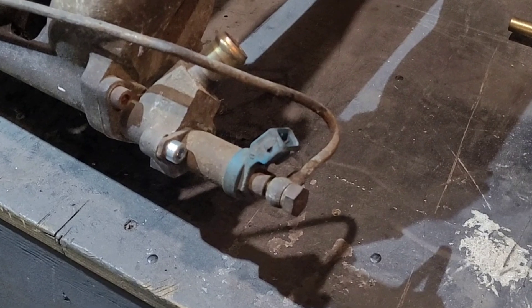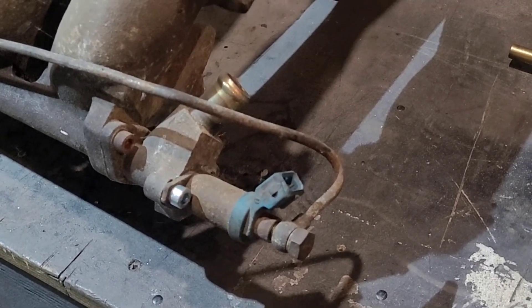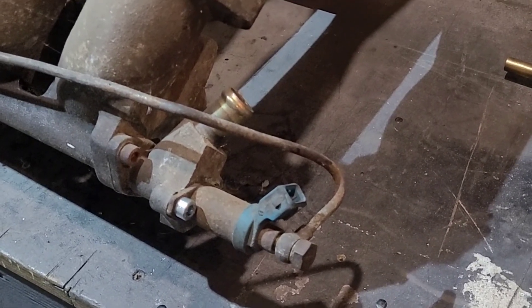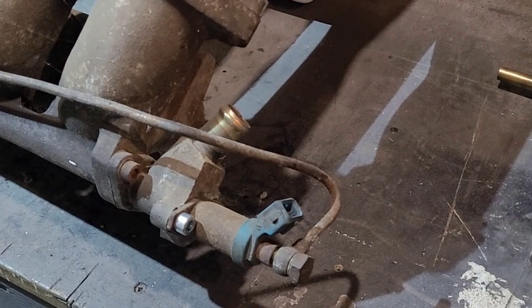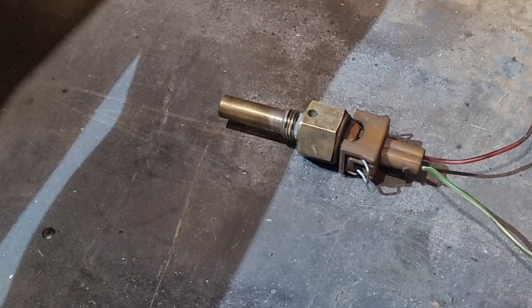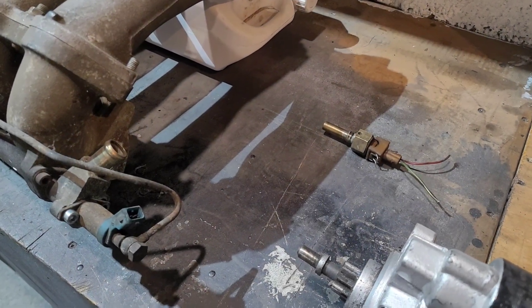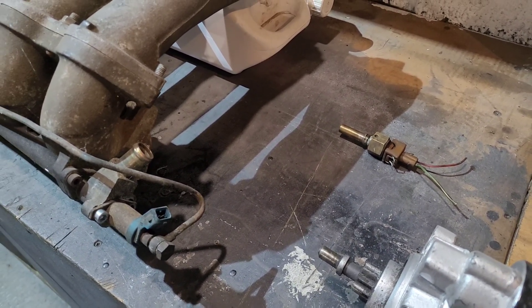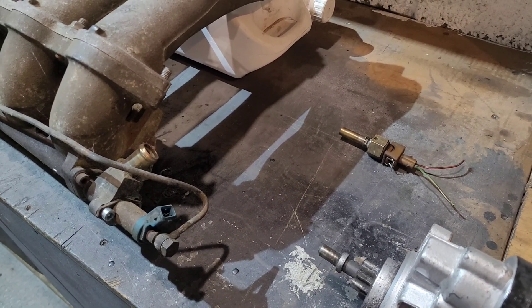The fifth injector operates, for example, at zero degrees for between three and seven seconds while the engine is cranking. In the UK you're probably not going to use these cars at zero degrees — more like five to ten degrees — so it'll only work for about two to three seconds. The colder the car, the longer it operates. The thermo time switch works alongside it: when cold it's closed, connecting the green and white wire to the fifth injector; when warm it's open, disconnecting it. Together these two components have a limited operation to prevent flooding the engine.